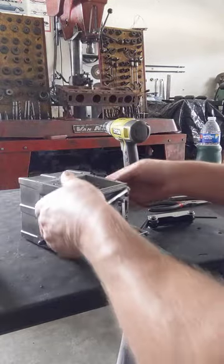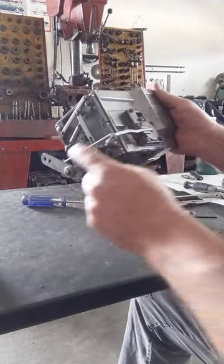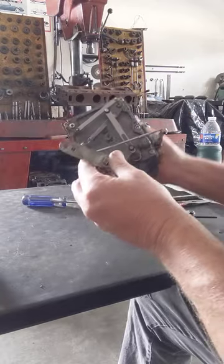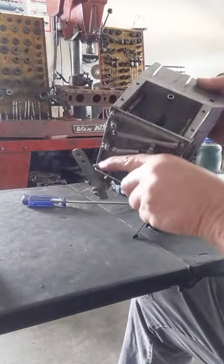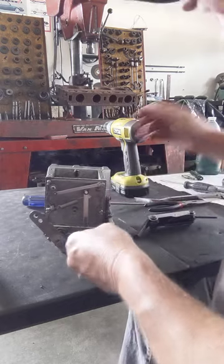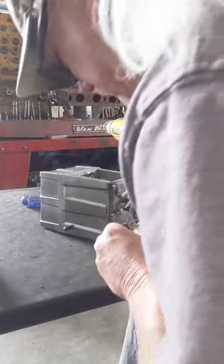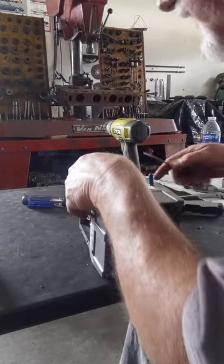All right, now let's go ahead and take this rod off because we're going to take the accelerator pump off. Now there's two ways of doing this. You can take the little clip off right here, so you can just leave this rod on there. That way you have less pieces to put in your box or your little bag. So we just gotta take that clip off, which is one small part. I hate messing with them.